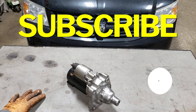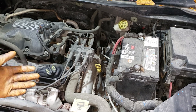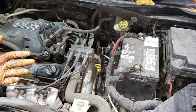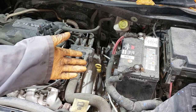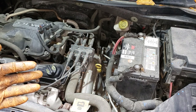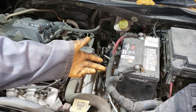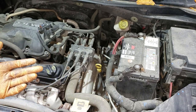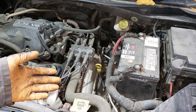With your hood open you want to look for obvious signs of crap. We have a few signs here, for instance we have a battery that is not the correct battery for this car. When you see things like that it is important to determine whether someone has made a mistake installing the battery or put the wires in a way that's going to chafe and eventually wear them through, because that can cause a no-start condition as well. We don't have that issue right now.